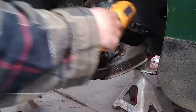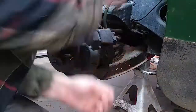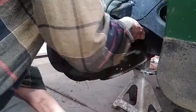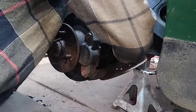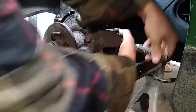It looks like the discs and hubs have to come off the spindle to replace the discs. First the brake pads come off, but they're really stuck in there. Instead I decided to take the entire caliper off and then just punch out the pads. The calipers are held on by two bolts, which is pretty typical, but the bolts are prevented from loosening by two metal tabs, which is not very typical, so you have to pry those tabs up or down before you can loosen those bolts.